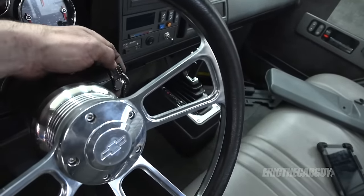Here's the result — I've stripped back the wiring and installed the tap clip. One thing about these clips: always check after installation — I cut the other end and tried to maintain continuity with the harness. I ran a red wire for the signal wire and a white wire for the ground. I pressed the brake pedal and verified this wire is sending a signal. Use a pair of pliers to properly squish the clip through the insulation and make sure you've got a decent connection. Now it's just a matter of running the ground and connecting all these wires up — pretty much color to color.